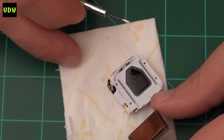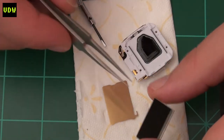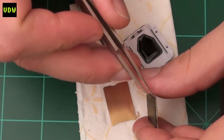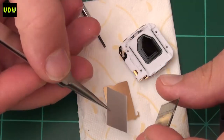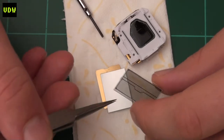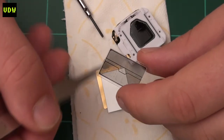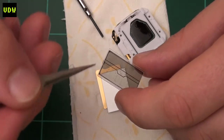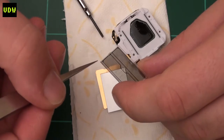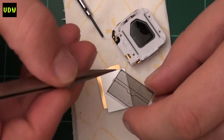There we see the LCD screen and the screen protector — let's see if it's glued to the back or not. In some watches, like the G-Shock Stargate series, the reflective panel is glued to the back — never peel that off. You will need a totally new one to glue on, and I've never seen a part like that available. If you start peeling it off you'll make ridges on it, and when you put it back those ridges will be highly visible.